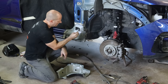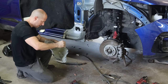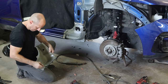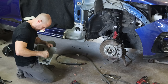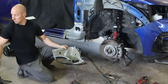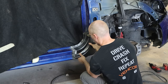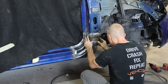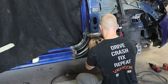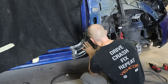We paint out all of the bonding adhesive to cover all bare metal — bare metal is just a place for rust to start. Fun fact: art class was almost the reason I didn't graduate college; turns out I'm more autistic than artistic. We stick our piece up with all of our weld-through primer on the back side, and put the bolts in carefully to avoid getting bonding adhesive on the threads. We give that adhesive plenty of time to cure.